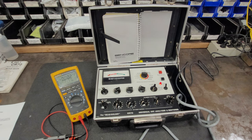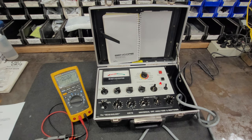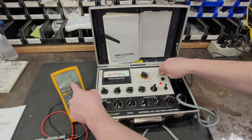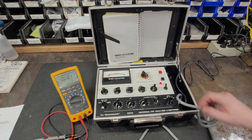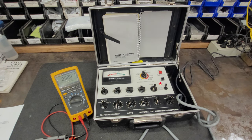The next test would be a manual restore one, and she should be between 80 and 120 milliamps DC. We had 115.3 milliamps right there - that's doing good. My manual restore two should be greater than 150 milliamps DC, meaning more than 150 milliamps. We're getting 168, 167 milliamps DC. I'm going to say that function tests good.